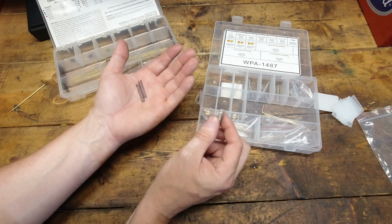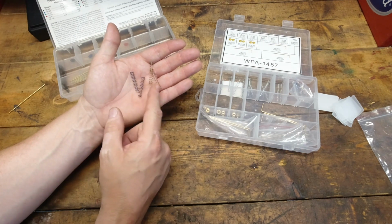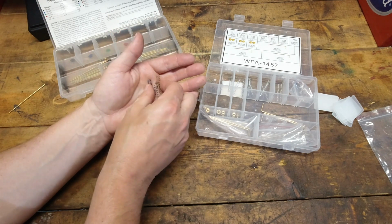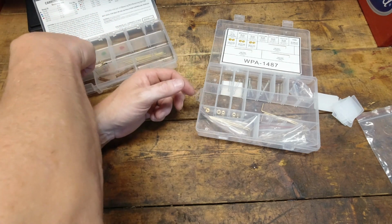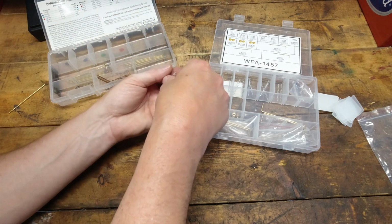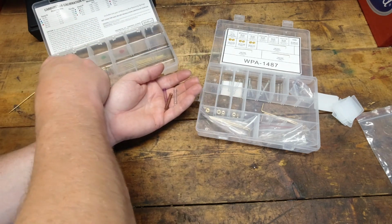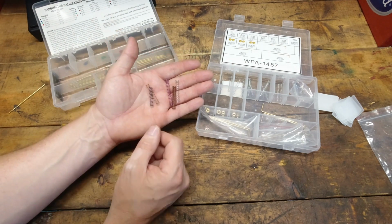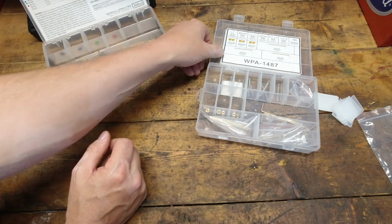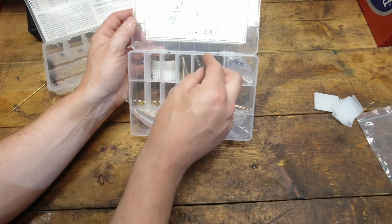Don't drop them, don't screw up, don't put them in the same place. Like, there's the next step up on the Edelbrock, that's the yellow spring. I could put all those springs in one deal. There's the pink, there's the silver, there's the orange spring, blue and yellow. They're all pretty easy to tell on the Edelbrock side, and I can throw those all back in one hole, no big deal. This one, well, no way of knowing.